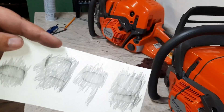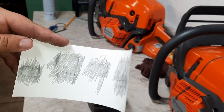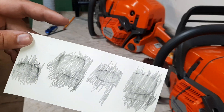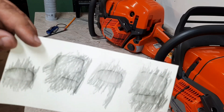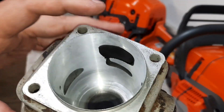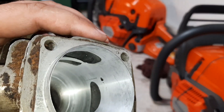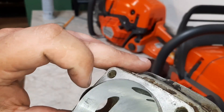Since this is the first go around, we'll just put small holes in to locate these ports, probably at the bottoms of all the ports. That way we'll just match them once we're done. That's what the port map looks like. Looking at the bored out cylinder again — you can see we broke through the transfer bridge a little bit, but that should be all right. There are a couple of pin holes that we're hiding under the plating.